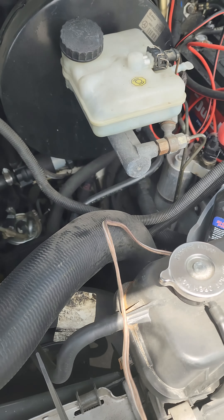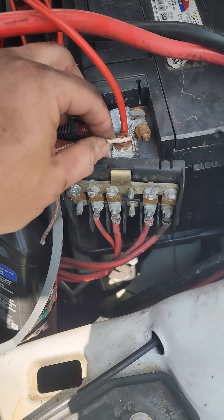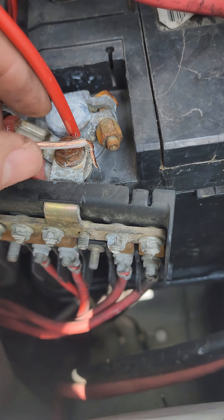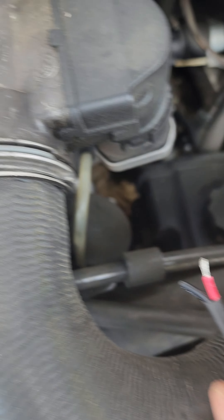Here's what you're gonna do to test your starter. You need to get a piece of wire, about two and a half to three feet long. Connect it to your battery — it doesn't have to be a really good connection. You're not gonna run a lot of current down it; mine's barely just touching. Then barely expose the tip there, so you don't touch anything along the way.